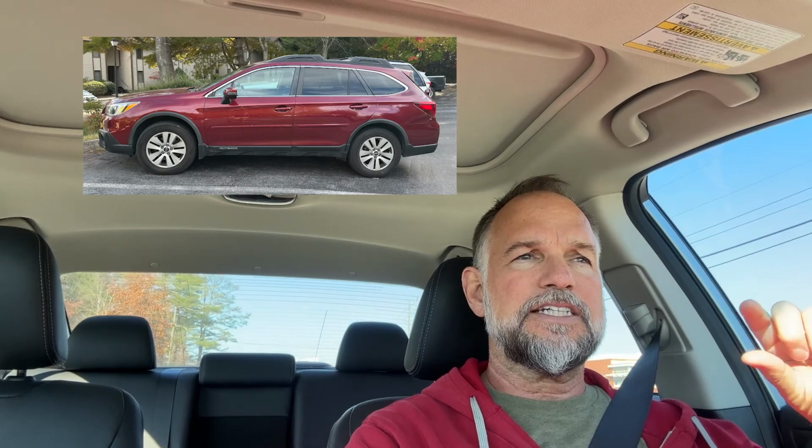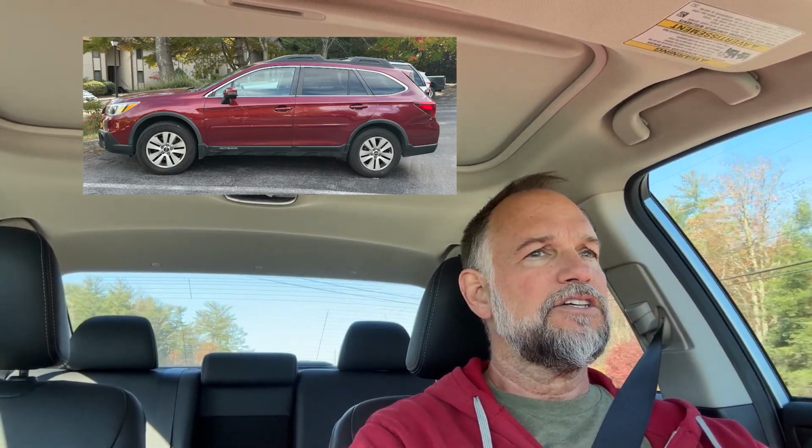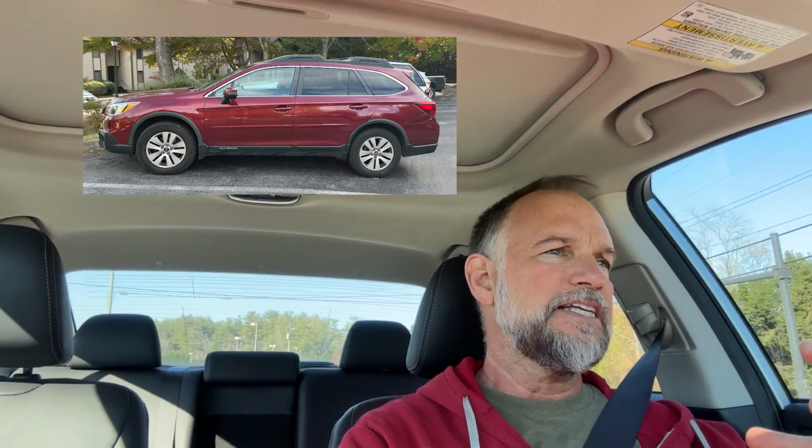But I'm hoping the new taller sidewall on the 17s, I'm going with a 225/65/17, will help. That is an OEM size for a Subaru Outback of the same year. So I should have no problems with alignment, keeping it within specs, stopping distance, rubbing, or any of that stuff. So anyways, that's where I'm at.